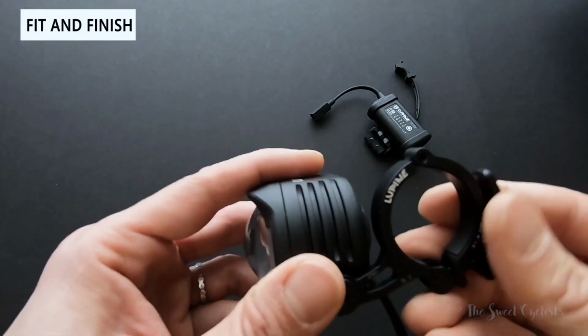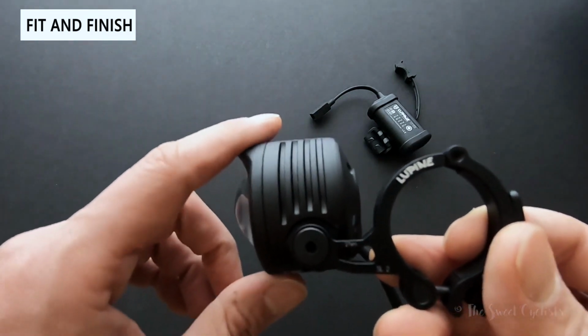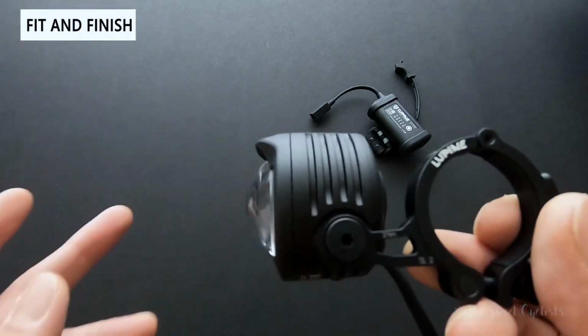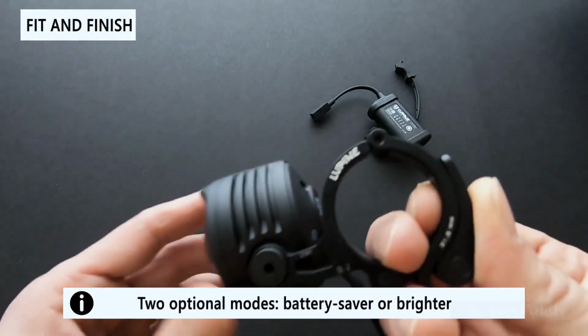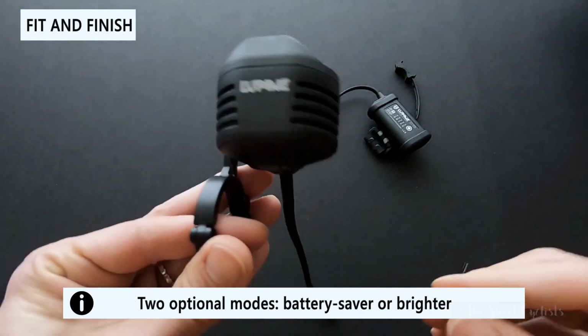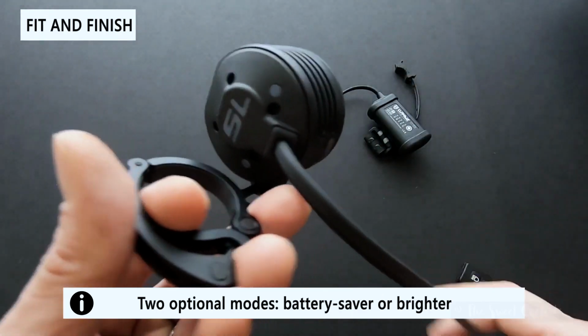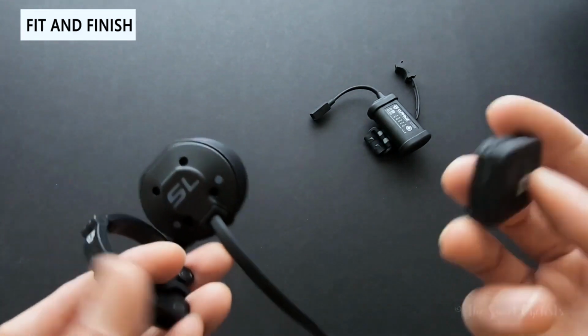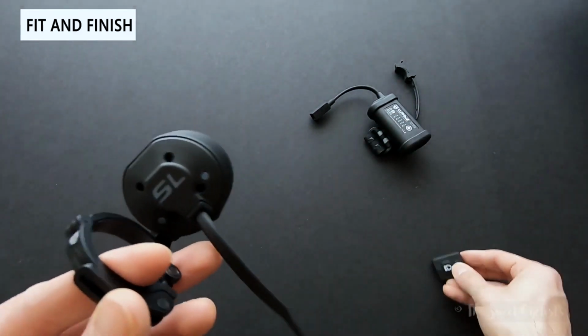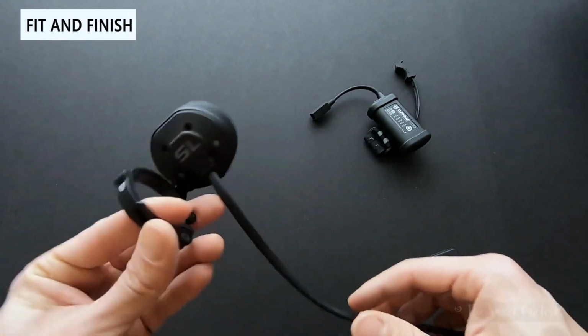You can adjust the light settings. So instead of using the factory 1300 lumens for the high beam and the 850 for the low beam, you can actually use that for both the low and high beam. You can use a lower setting for the high beam and a lower setting for the low beam. You can disable the ambient light sensor if you don't like it and make it a manual mode. That'll make it manual. So if you hold the bottom button down for 2 seconds, that'll activate the DRLs.